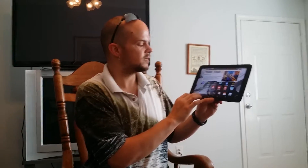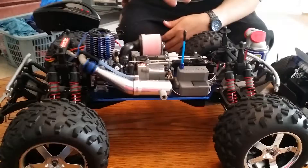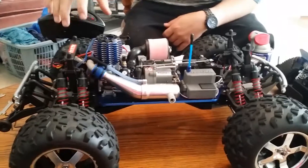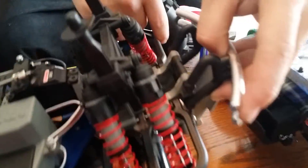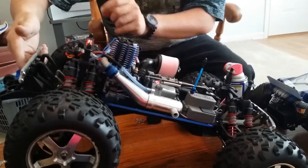That's probably one of the coolest things about the T-MAX. The biggest upgrades I'm going to do are aluminum shock towers, aluminum bulkheads, aluminum A-arms, and four-wheel steering — because it uses the same knuckles front and back. The back has the same setup except the tie rods are locked. You can move the fuel tank and add another servo for rear steering.